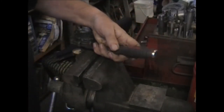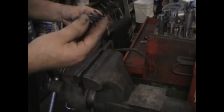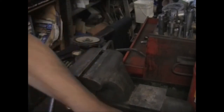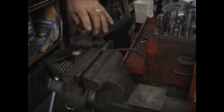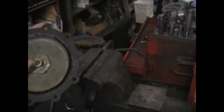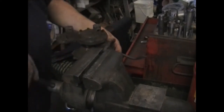Put a putty knife in between the two pieces and give it a few taps. That's the spring that's in between there — it's got a lot of pressure underneath it, as you saw when it let go. These are your inlet and outlet valves for the vacuum side. Your diaphragm is a quarter turn to unlock it out of these two notches and takes it off the link. Take that nut off. With this particular one, the diaphragm assemblies don't come staked — they're just diaphragm material, because everything is bolted together.